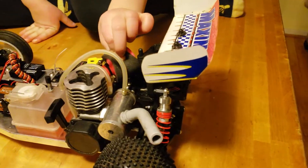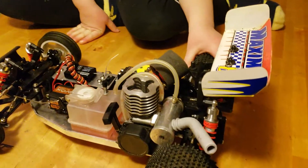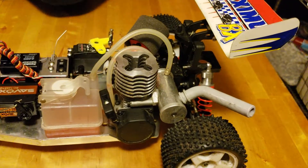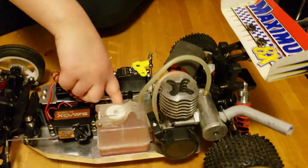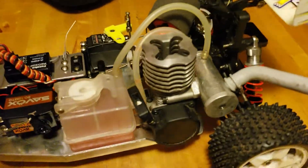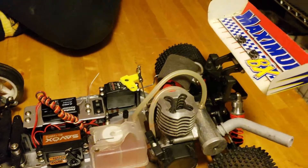My first one of these made it into two other cars after the Max Buggy it came in. This one runs pretty good, except it leaks excessively out of the front bearing. The fuel for these cars is pink in color. That fuel leaks out of the front of the motor a little too much, so I'm gonna have to tear it down and measure that bearing and see if I can order a sealed bearing for it.